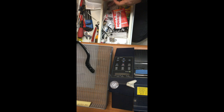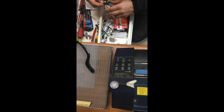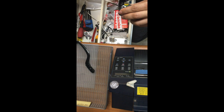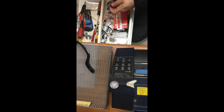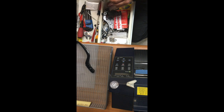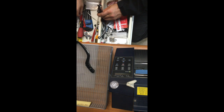For this video, this is the most trouble I've ever had. I think the reason why is because I didn't do the screwdriver in quite far enough — yeah, that's why I'm struggling. Should go much easier now. Just put the split pin back on, get it lined up with the hole. A really good idea is to use a bigger blunt object like this Allen wrench so I don't deform the pin at all.